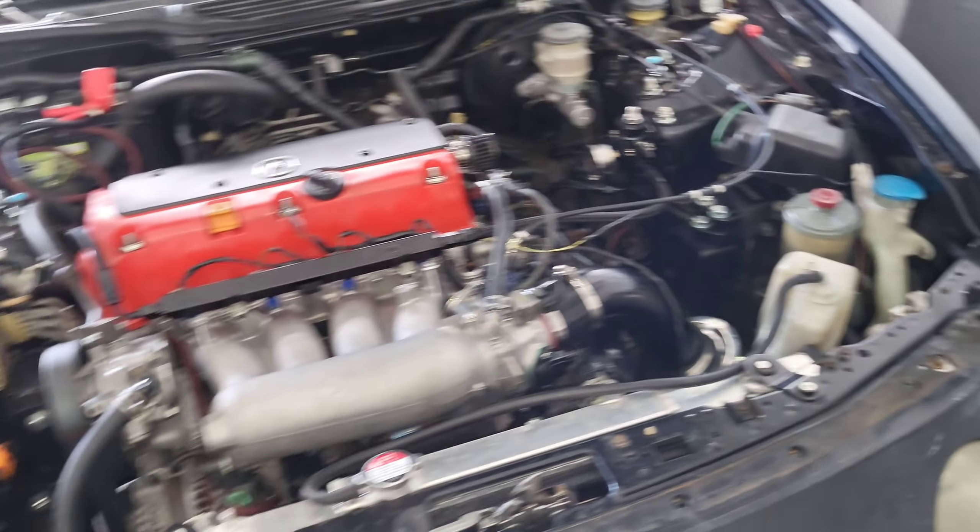With the way it's sitting right now it's only at 86%, so that's going to cost me a couple horsepower because the throttle body is not opening up completely how I want. It does say the TPS is opening over 100, but it's only reading 86 at wide open throttle — that's not what I wanted. If it were giving me 90-something I would just cut my losses and keep it.